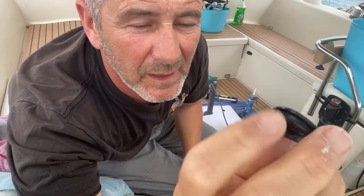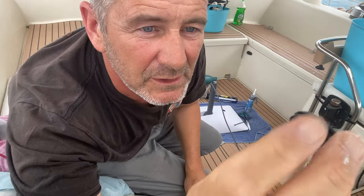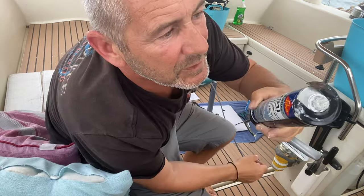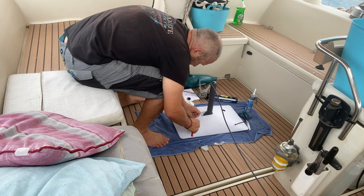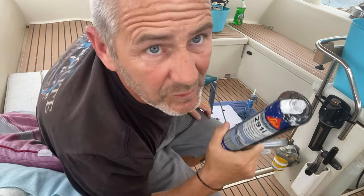The next thing was to plug the holes. I've got a 23mm rubber cap — the 25mm didn't seem to fit, I just couldn't get it on at all, and this one seems to be more in line with that hole, so we'll give that one a try. I know it's going to be on the underside but drips can kind of come down and find their way in the gap, so if I put a little bit of Sikaflex around the edge, hopefully that will act as a drip guard on both holes.